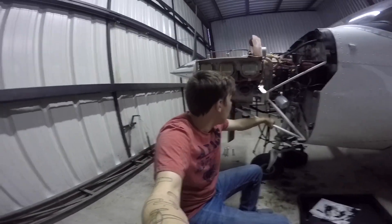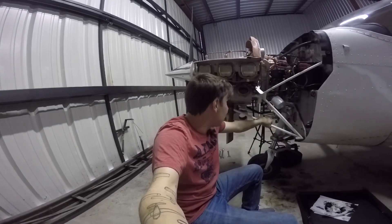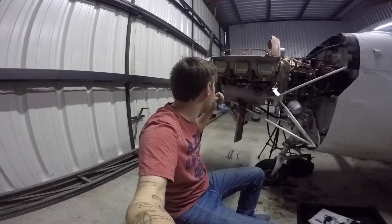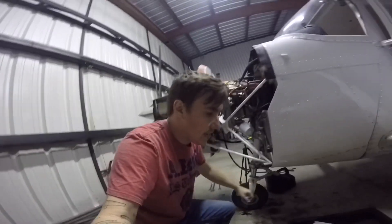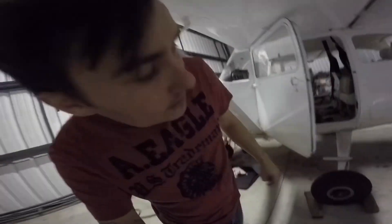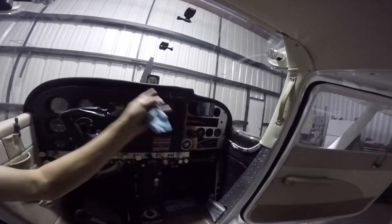That's going to do it for this video. I realize I didn't get a whole lot done, but it's kind of all the time I had today. I'm going to get cleaned up, pick up all my tools, and head to the house and get ready for work tomorrow. I do still need to call JPI — I got to get the right CHT probes; they had sent me bayonets and I need gasket probes. The next episode is going to get pretty intense: putting all the sensors and getting things wired up on this side, as well as getting the JPI wired up on this side. I've obviously got the shunt, and I'm also doing fuel senders, so a lot of stuff. If you haven't watched any of the previous videos in this series, make sure you go watch those — I will make a playlist for all of this as I go along.